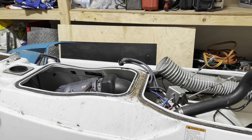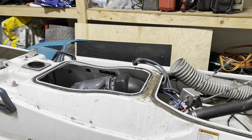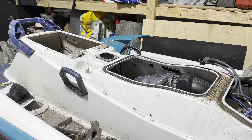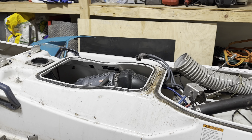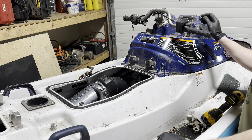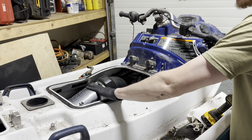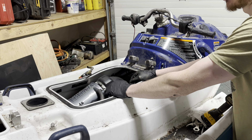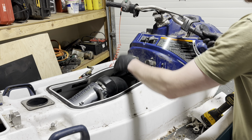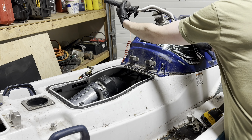At this point I've got to get all of that put back together because all the wires are apart and nothing's actually attached, so I couldn't start it right now even though I did pull a battery out and have it ready to go to actually test this thing. I've got everything loosely put together and I'm going to be kind of surprised if it even does anything — regardless of whether the motor is locked up — because those battery cables are so corroded that I'm doubting they're going to let any current flow. But we're going to go ahead and try it out.